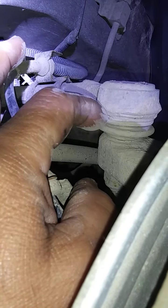This works the same for these. If you catch it when this rubber piece cracks and deteriorates, I'm going to show you, this is going to take 20 minutes. If you want to see forward, then I have to let it sit for 24 hours, which I'm going to. But this rubber boot, it's all sealed. You can't grease them anymore. They're all just sealed, and you can't keep them lubricated. So if the rubber seal goes, you can't just grease it every month or so. If it gets a crack, it's going to wear out in a heartbeat.